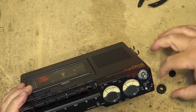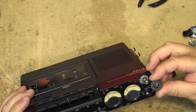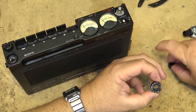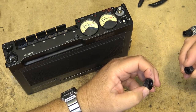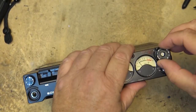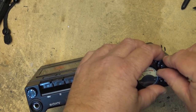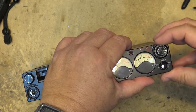All these types of knobs that had a metal finish had plastic inserts and they were just glued together at the factory. When you glue it, make sure you don't get excessive glue around the inside, otherwise it could bind with the other control. I've wiped out any excessive glue so there's nothing for it to get hung up on. Now the epoxy has set up, so we can put the knob back on. The two knobs are individually adjustable.